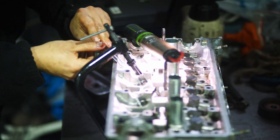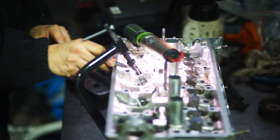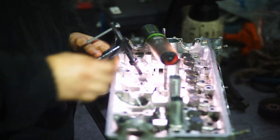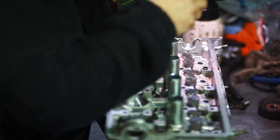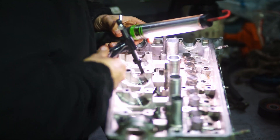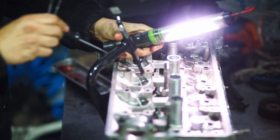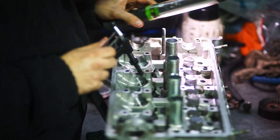That can also happen if a valve is hammering itself into the seat and the clearance tightens to zero. After adjustment the head is pretty much done, so we can put everything back together. I won't show putting the head on the car, but I will show how to break in the engine correctly, because there are important steps many people don't follow and some misconceptions I want to address — it's one of the most important steps in rebuilding an engine.